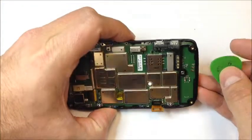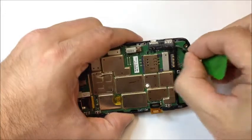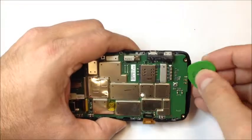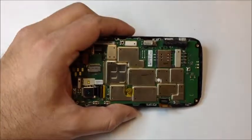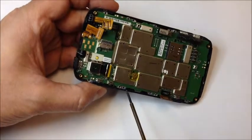Down at the bottom, you'll see a little rubber gasket that tends to fall off at some point — I'd recommend just getting it out of the way. From here you can get under the board, but there are a couple of plastic clips holding the logic board in place here, and another one on the opposing side.